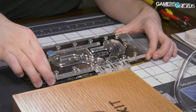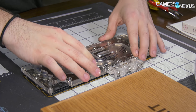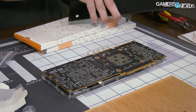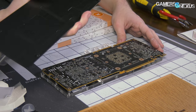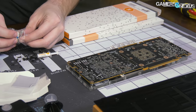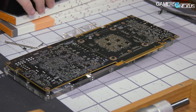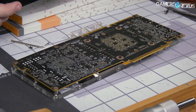Next step, we're going to start installing the block. This will just sock it down very easily. It's going to be a much better cooling solution than our previous one, although our previous custom-made hybrid was very good. The back plate is technically optional, but it's going to mount on just like that — it looks pretty nice, actually, that brushed look. We do need to get some thermal pads on there and also a couple of mounting screws to secure it to start with. Six screws will be omitted to add the back plate, and then we can do the rest.